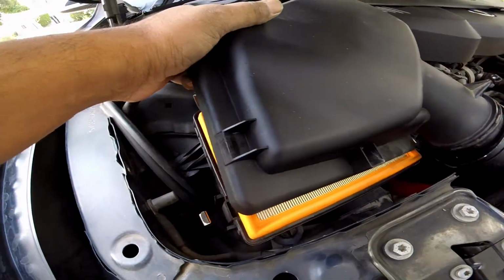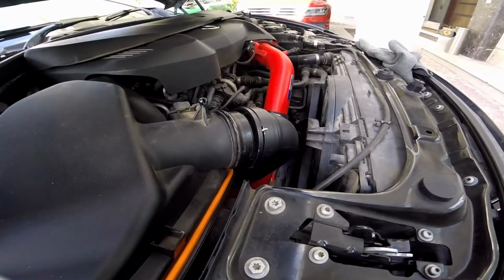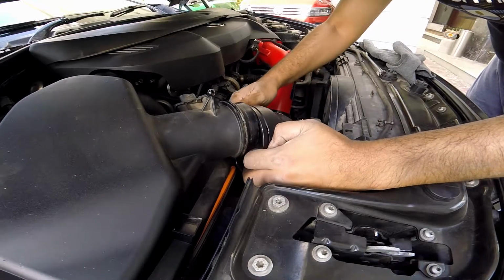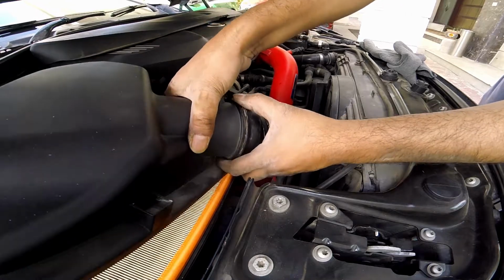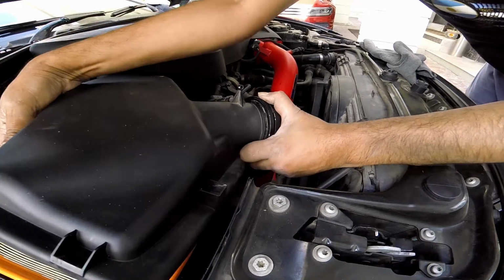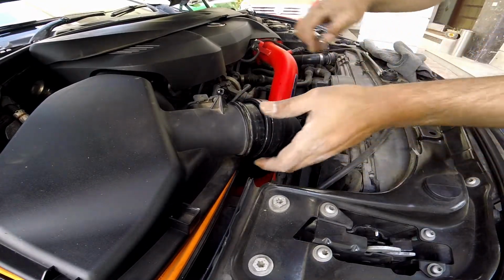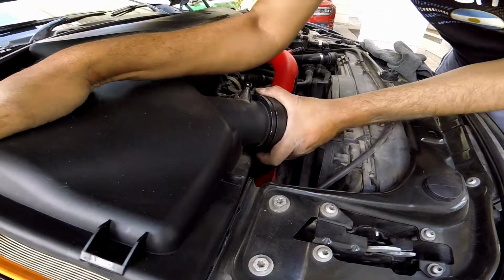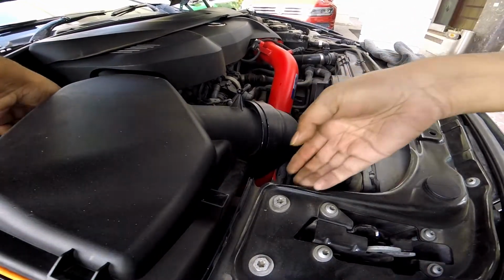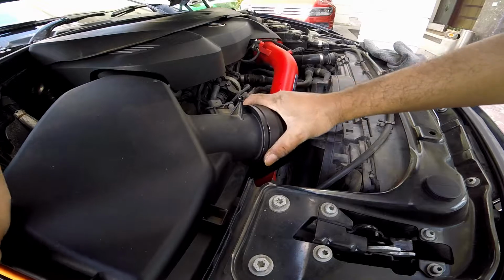For the airbox cover bit, remember, this was held by a pinch clip, now it's held by a C-clamp. But we'll do the same thing, we'll lower the C-clamp off its hinges and then just slide this piece in. Should go in pretty easily. I might have to remove this clamp. Much easier with the clamp out. So okay, now you can maneuver this in with the airbox. Bit of a pain to do, so just turn it.